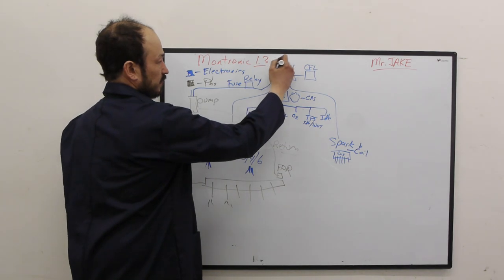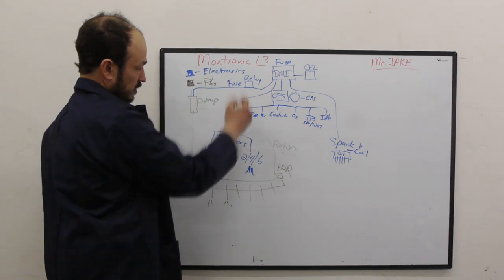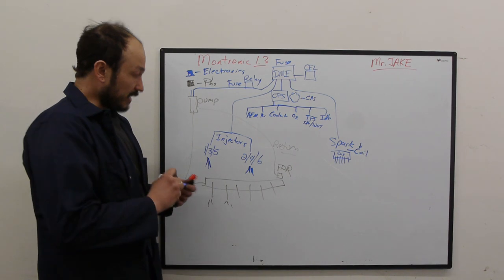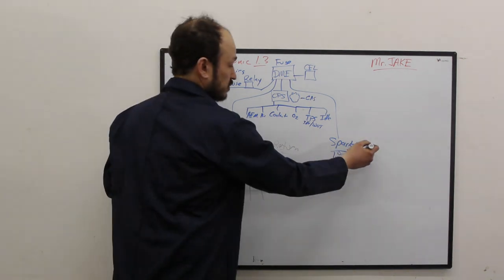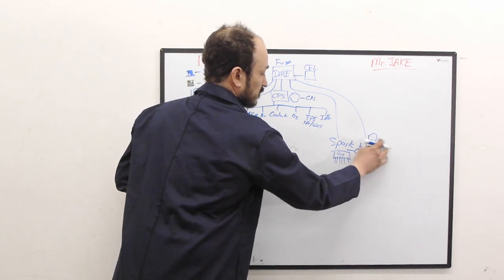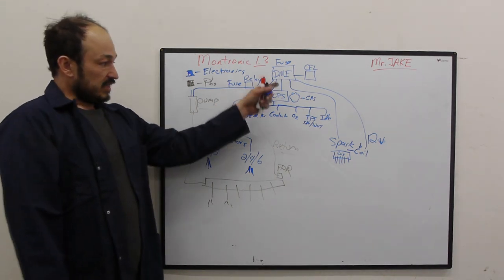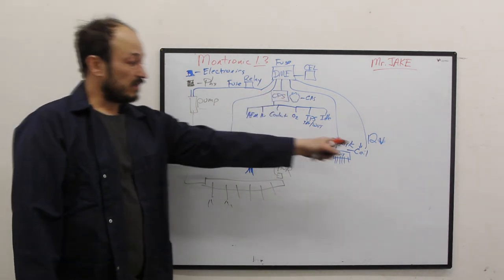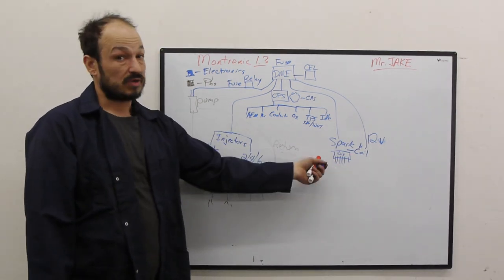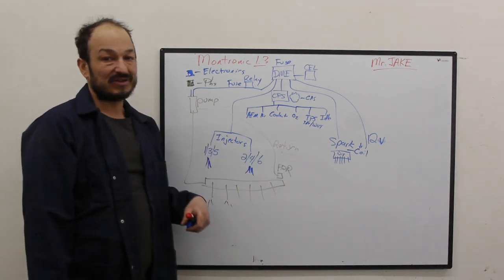Okay, also in this relay, there's a fuse here. This DME also has a fuse, okay? The injectors, which are controlled here, have no fuse, all handled by that fuse up there. So then the coil has power to the DME, has 12 volts, like so. So the DME, which is also using the crank position sensor, fires the coil. The distributor is then spinning around in the right order. Make sure you have the plug wires in the right order. Then we'll distribute spark to the right cylinder at the right time.